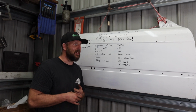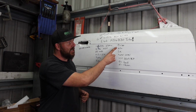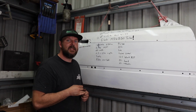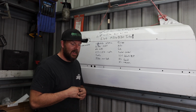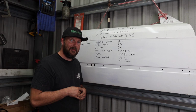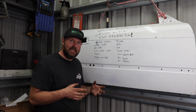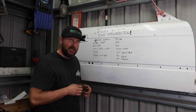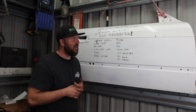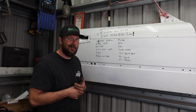Because we've got turbo and more bang and stuff, we've gone for ACL race bearings. They have a very good selection for BMWs. I totally recommend them. I wouldn't recommend King bearings, they fall apart and break stuff. Also on heat management, so because things are getting hot now where there's not supposed to be heat, we've gone for Funk Motorsport heat coverings on everything. They are very good. Not the cheapest, but I'm not skinned.